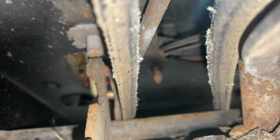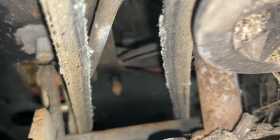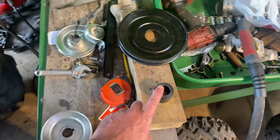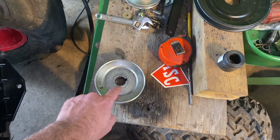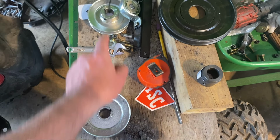So I've got the 7-inch pulley sitting in place. It rubs on the, was it left side? Right side would be fine. It's not rubbing, it's on the outer pulley just like it's supposed to be. So that side would work. So the plan is to take back this hub, this pulley, that pulley. I don't need two that are alike. Drill a hole in this one, I gotta buy a key. This one, when I took it off, didn't even have a key in it. So we're gonna use the 4.5-inch, take this back.